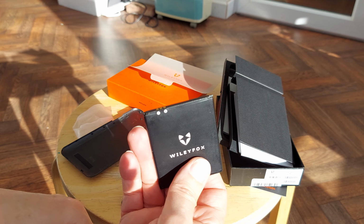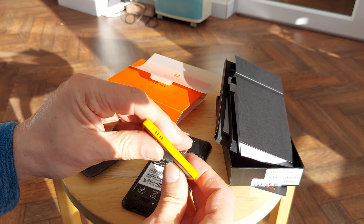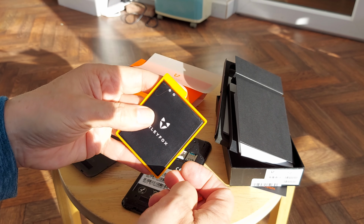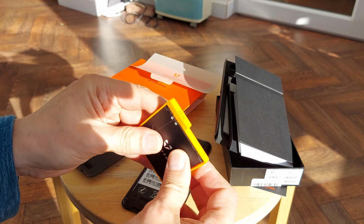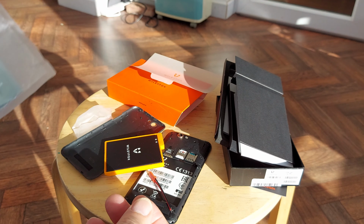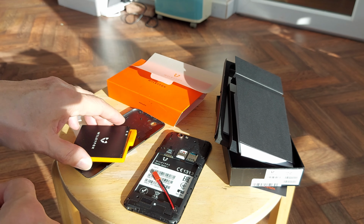I took the battery out and charged it externally, and I thought if I had to do that more than once, I'll make myself a little frame for it. So I'll put a couple of little tags through there, one of my JST connectors on it, and then I can just plug it into my normal charger. So a bit of 3D printing. Cut some very thin metal strips from this nickel plate. So go through those holes and line up with the outer two tags, and we should have a little charger.